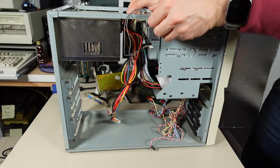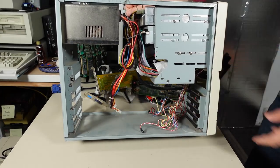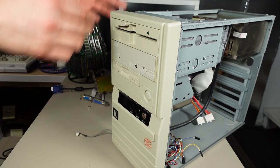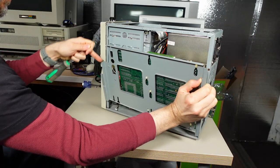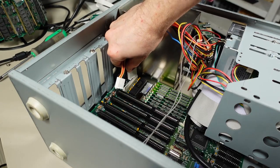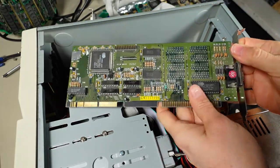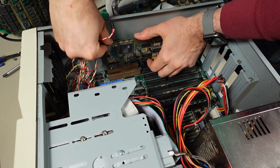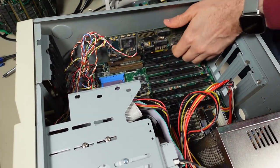I'd like to turn my attention to the computer case a little bit before I reassemble it — there's just a little bit of dust in here. I just did a very quick clean, but this thing cleaned up very nicely. All things considered, I think this computer was from 1993, so 27 years old — it's in incredible condition. Time to reconnect all of the front panel connections using the picture I took earlier. Then inserting the motherboard, you just slot that in and reinstall the two screws. Connecting the power supply, just make sure the black wires are towards the center — that's the very important thing to always remember.